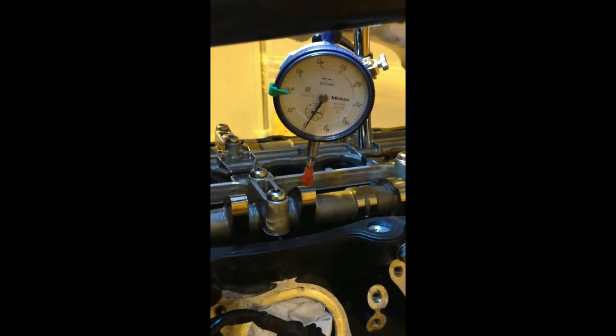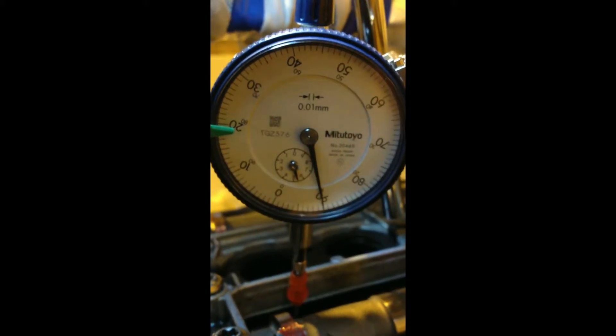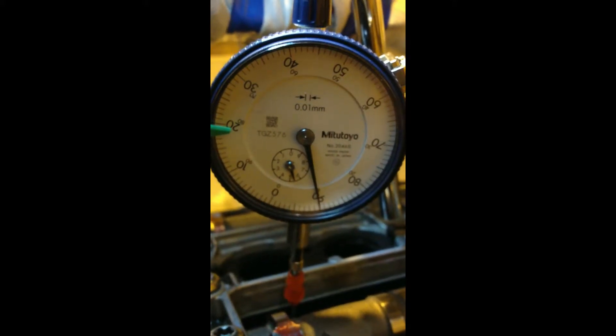These lobes will turn in and start opening the two valves, and this indicator should go back around. I'm just going to put down the camera to turn it — it needs to be a two-handed operation, otherwise the cam will turn the thing open too far. After moving around, it's dropped down by about 2.1 millimetres.